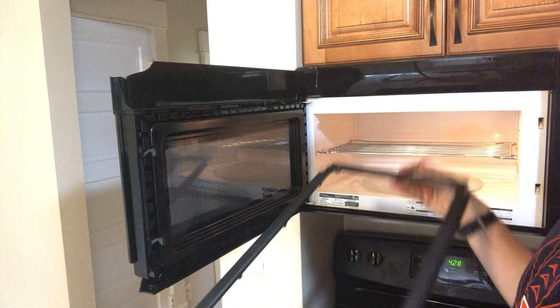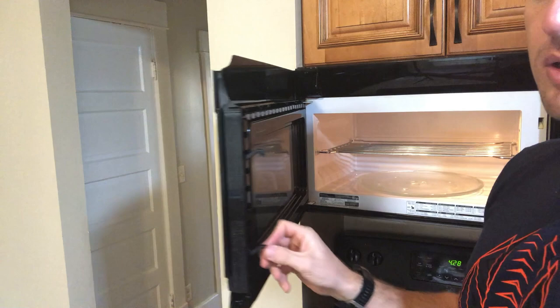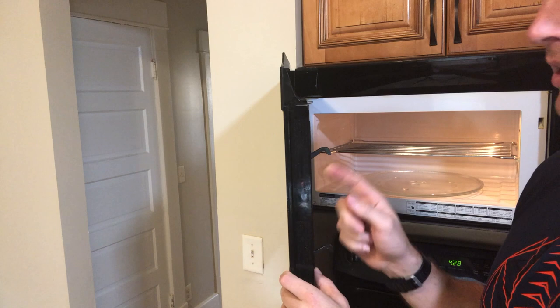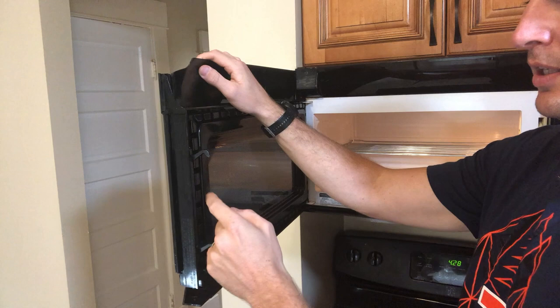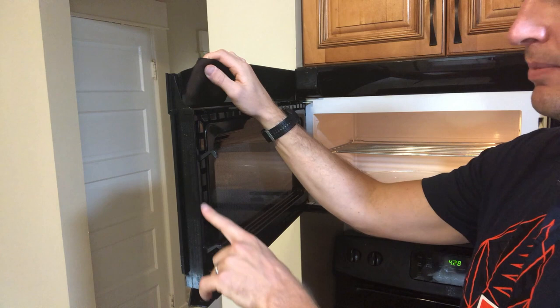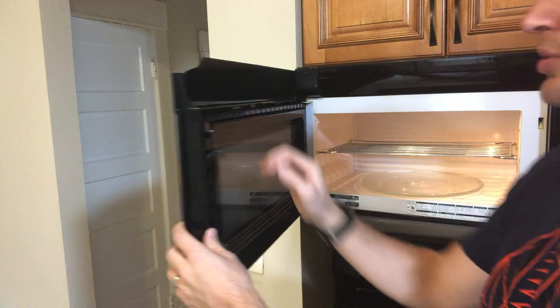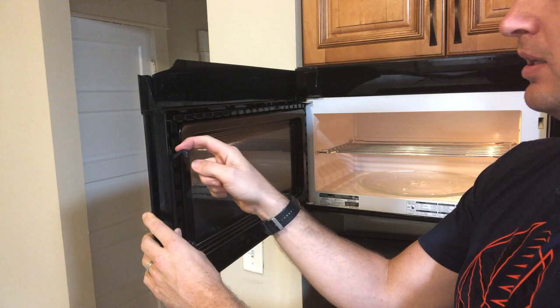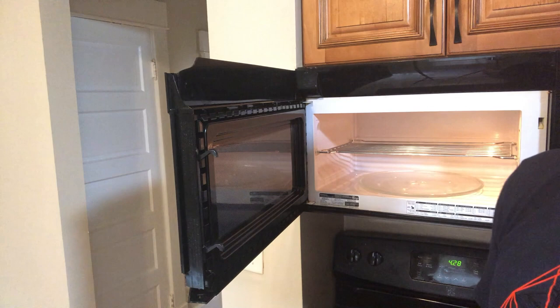With the cover off, you can see other common components. The latch is a very common failure point — it's plastic with a spring mechanism. This can break quite often. If your door shuts but doesn't stay shut and keeps bouncing off, that probably means the spring isn't creating tension on the latch. There are videos showing how to drill a hole and remount the spring so you don't have to buy a new one. In our case we have a full blowout — the door is broken — so we're replacing the whole door.